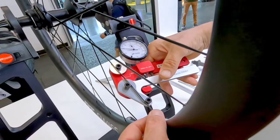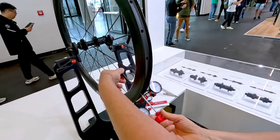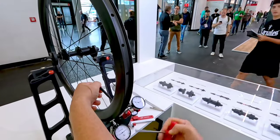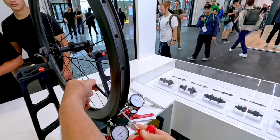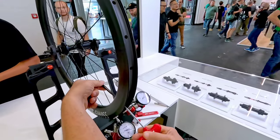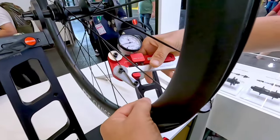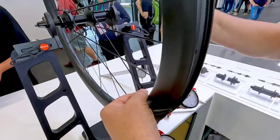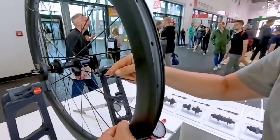Now the next one is too high already, so here I do the opposite — I am loosening that spoke a little bit, and I am again losing my side kick, so I am also loosening the other spokes on the other side to maintain my side kick and get the tolerance that I want. I do this on the whole high side here, the rotor side, until I am in every tolerance necessary.